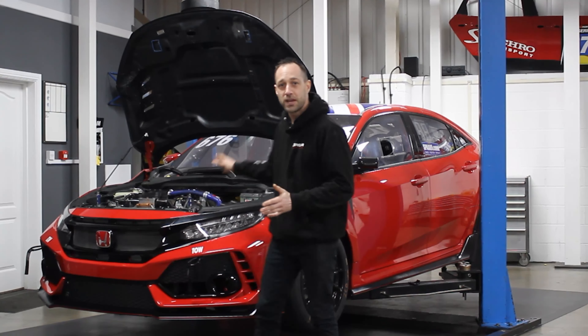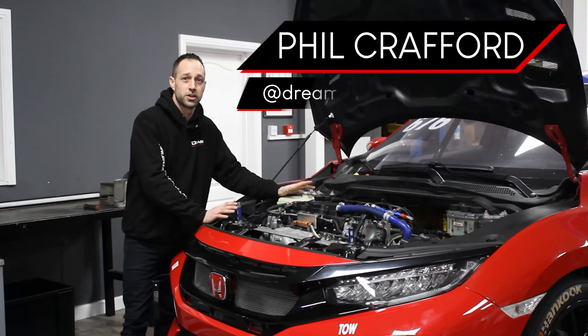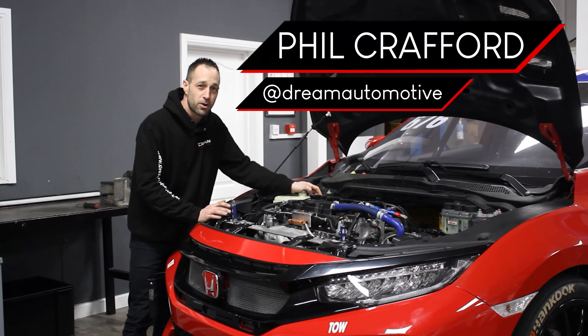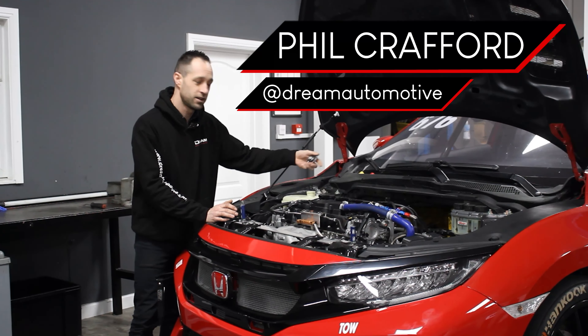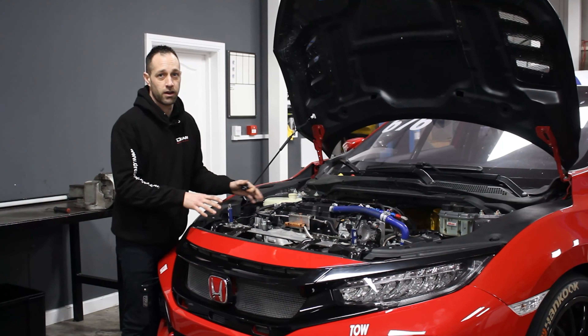Today you join me in the workshop and we're here to remove the engine out of the race car. Previously mentioned the car seems to be burning coolant. I can confirm this - if we have a look in the expansion tank here, that's empty. We've already seen coolant coming out the exhaust in the previous video, so we're going to see if we can find out exactly what the root cause was - whether it was head gasket, whether it's a cracked cylinder head or even a cracked liner. But we're going to get the engine out and get it stripped down.